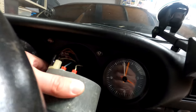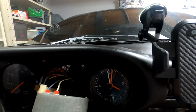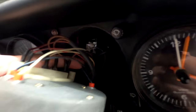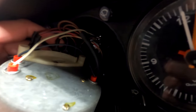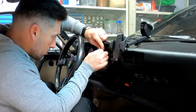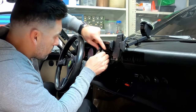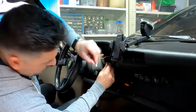Remember that your battery negative cable needs to be disconnected before you proceed with the rest of the gauges. On my SC speedometer, there are two illumination bulbs — one down there and one up here. We'll replace those the same way as the clock, but without the spacers. No rocket science here — just pull the bulb out of the back of the gauge, quarter turn to remove it, grab the LED, quarter turn back into the socket, back into the back of the gauge, and same operation with the other one.